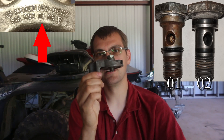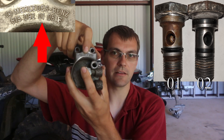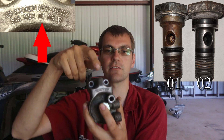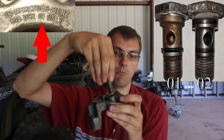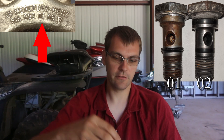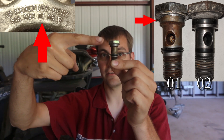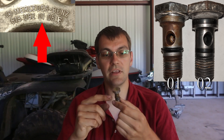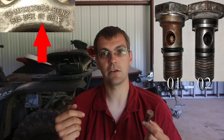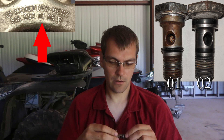Let me show you what I did and how simple it is to change. If you have the O1 style — I'm saying O1 because the part number has an O1 in it — the bolt uses an aluminum crush washer up at the top, and an o-ring down at the bottom. You'd replace that o-ring and that crush washer, and that would solve your leak.